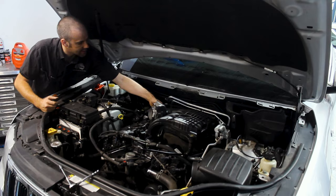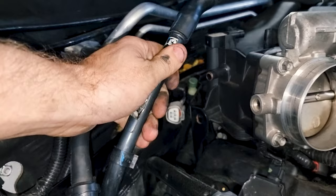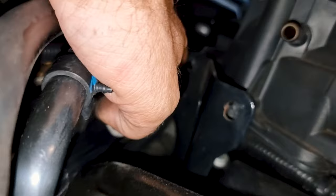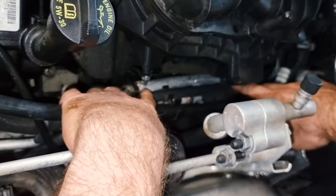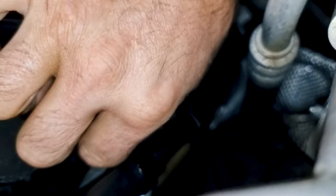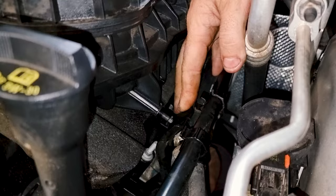You've then got two big vacuum hoses on the back of the manifold — they just slide off, there's no clamps, you just pull. Oh, I lied — there is a hose clamp on the end of that one, so undo that hose clamp before you yank on it. Someone's been in here before us. There's normally 10mm studs on here with a nut. Normally there'll be a 10mm here and another one here, and two more on the other side. Further down there's a 12mm where the bracket bolts to the head — you need to loosen them, don't take them all the way off, just loosen them. The 12mm is still in but loose, so it doesn't fall but it allows you to move the bracket.